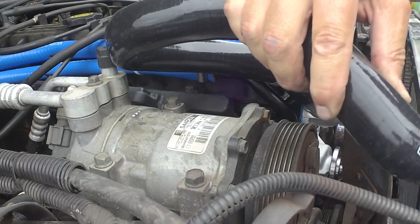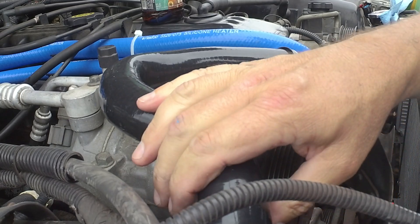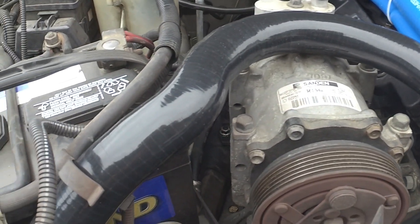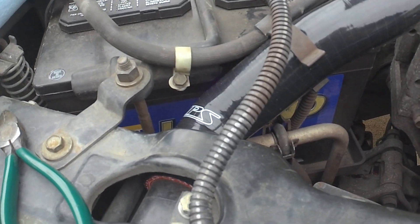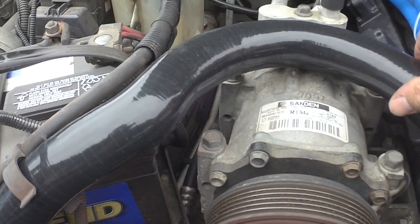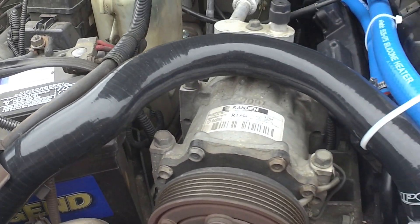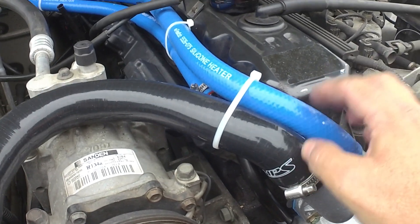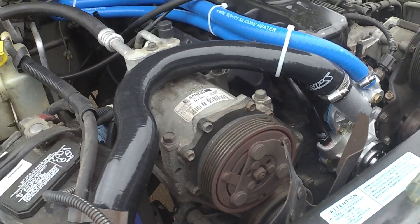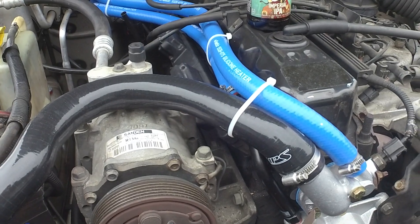My overflow hose here — we're going to try and work this in. We've got the top radiator hose in; you can see the band and contour of it looks pretty close to factory. The factory hose had a little plastic sheath around it that was kind of chewed up, but it's not actually rubbing on anything, so I think I'll probably leave it as is. I did zip tie my top heater hose in just to keep everything under control. So far it looks really clean — everything's nice and snug. Got to do the bottom hose now.